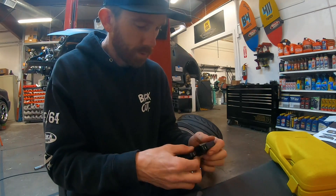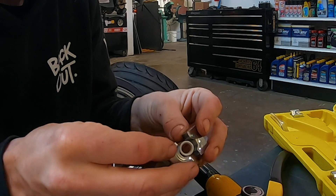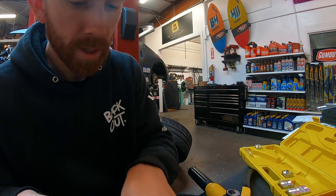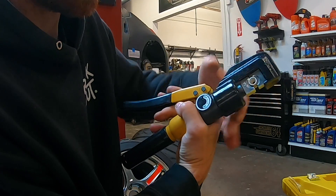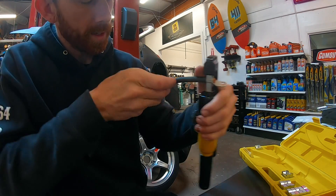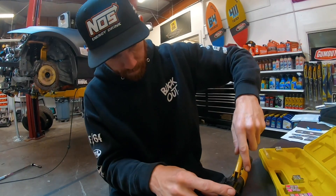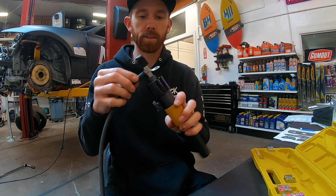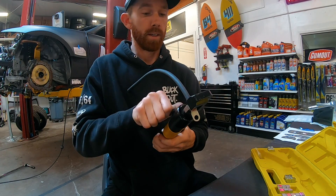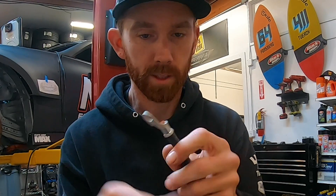Now I'm going to show you how this cool little tool works. I'm going to swap these guys out for the proper size. What you're checking for when fitting them up is that you have two guys together, and you can see there's a little bit of a gap on the top and the bottom, which means it's going to have room to crush and give a nice smooth contact all the way around. Get it kind of loaded so it doesn't fall out and it's easier to handle. If you're going to do heat shrink, don't forget that. Push that guy in — that's good. Give this guy a what for. Now it's starting to grab the wire. See how it almost comes all the way together — it means we got the right size. When you release that, we got a nice awesome crimp all the way around. It's never coming off.